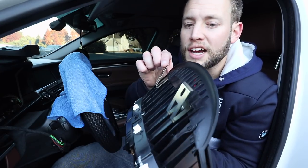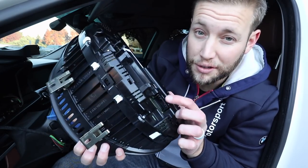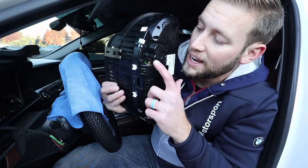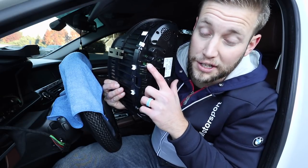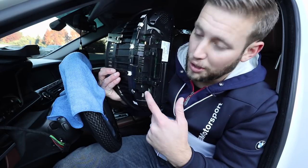With our new 6WB cluster you can see it has those same clips and that same connection. On the 6WB it also has an extra connection — this is for heads-up display. If you have heads-up display, connect that extra connection; if not, just go with the main plug.